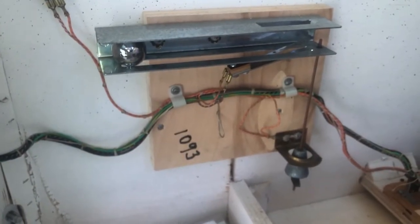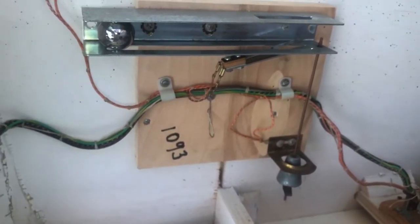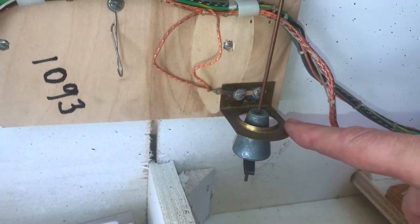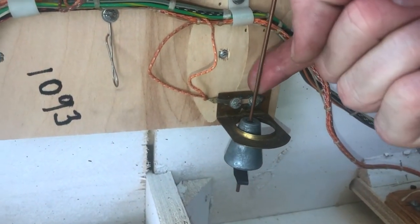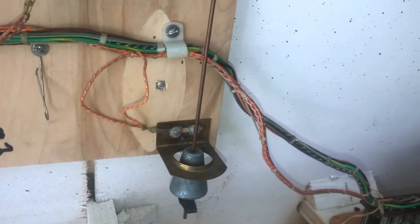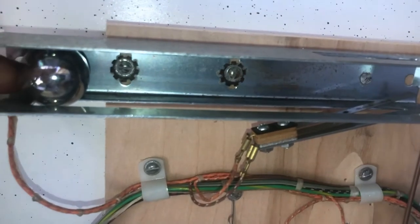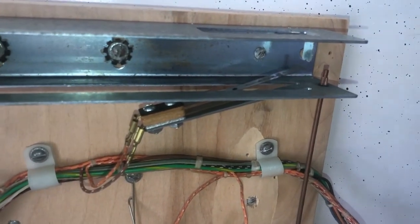Next we're going to look on the inside left wall of the cabinet. These are two tilt switches that are probably the most familiar to most pinball hobbyists because they're the most obvious two. The first is part of this mechanism: there's a rod that comes down with a weight at the bottom, and it hangs through this metal ring. If the game gets bumped too hard — maybe you're nudging it while playing — this swings and touches that metal ring, completes the circuit, and ends the game. The other one is right above it: there's a pinball used as a weight that will roll. If the game were to be picked up, this would roll all the way down, close this switch, tilt the game, and end the game.